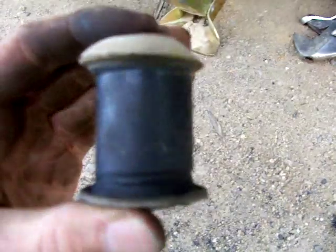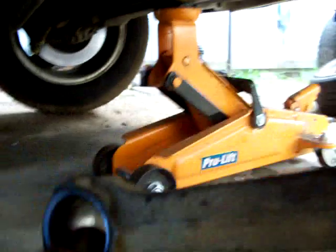So it's a funny shape. It's sort of twisted, so it's obviously had play in it. Now, generally you end up with rubber being left behind in the bore. So that's what that is there. That's not dirt, it's just rubber that's been left behind. Okay, the top of the bore is fairly clean, and you'll have to clean all that out. Can't leave it like that. But the bush is just fractionally smaller than it's supposed to be.